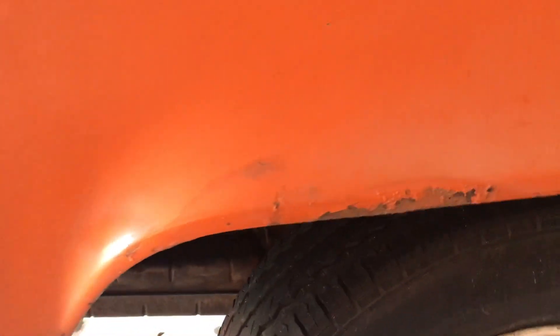There are signs of repair over here and some holes down here. The battery trays on this one are basically shot, so that's gonna have to be redone. Some rusting here — she's been repainted once, but they didn't do a good job on prep, so that paint's coming off. Looks like they didn't mask off properly or remove the trim pieces, and all the weather stripping is cracked.